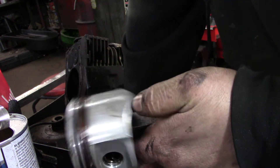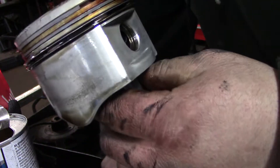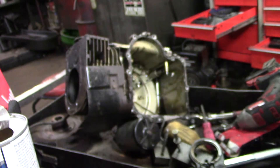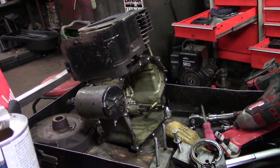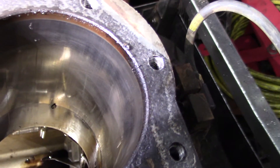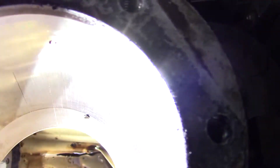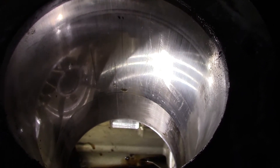Pretty scored there. As I said, this video is just me tearing this engine down and showing you some things. Let me look in the cylinder bore — it's like changing the oil wasn't number one priority on this one. I may be able to clean that up — a little wee bit of scoring, it's not horribly bad, it's just a piece of dirt down there. Not horribly bad. I thought I was going to have to bore this side, but it doesn't look like it. Looks like a new piston and set of rings and it'll be ready to roll.